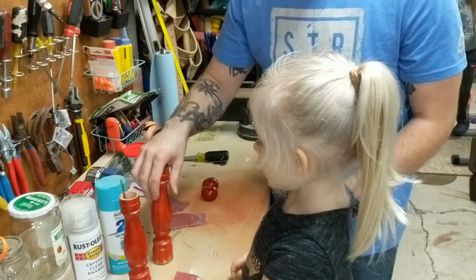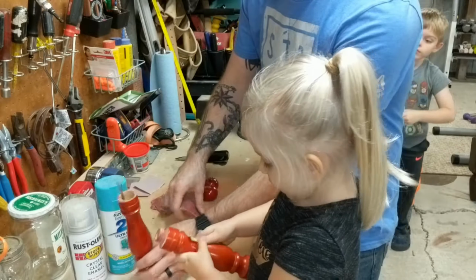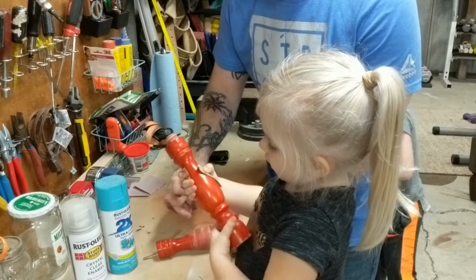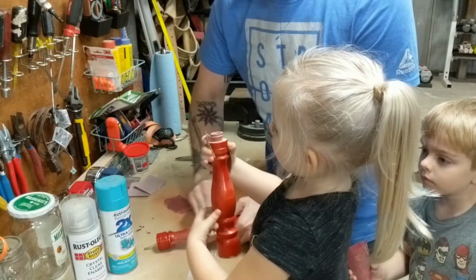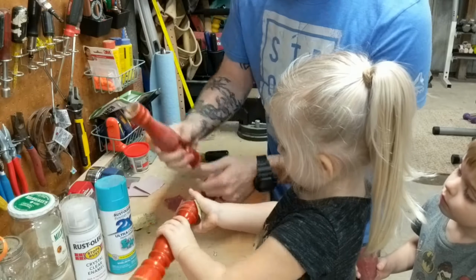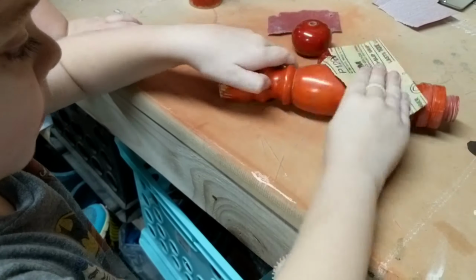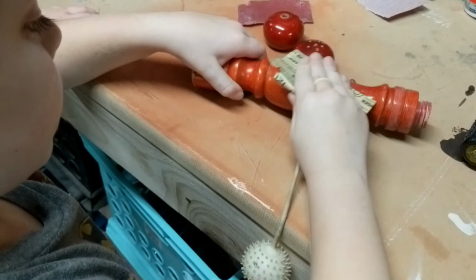Okay. So you work on this one. Just take this and just rub it on there. You gonna do it? Just like that. I'm rubbing it like this. That's right. I rub it around so all of it can get it. See? We don't need to take all of it off. We just want to rough it up enough to create a new surface for the paint. Too much. So do a little bit. Take your time. Don't go too fast. Just a little bit at a time.